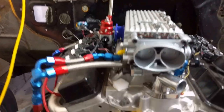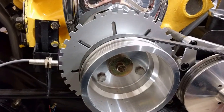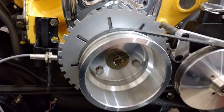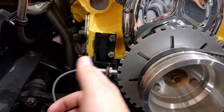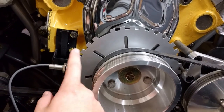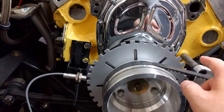The rest of the control system that allows me to do that — number one is the crank trigger system. This is a 36-tooth wheel. I got this from DIYAutoTune.com, the same vendor that I get the MS3 and the MS3 wiring from, along with this hall effect sensor. Essentially this wheel spins around and when the sensor picks up that there's a tooth missing, it knows that it's made one full rotation.